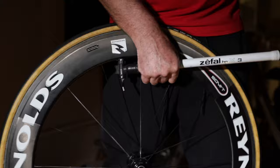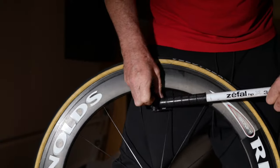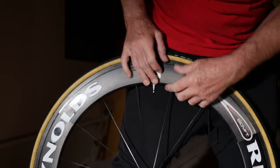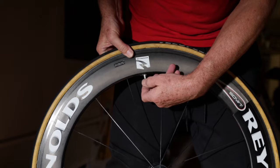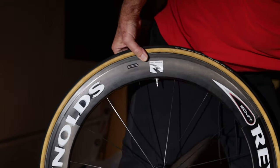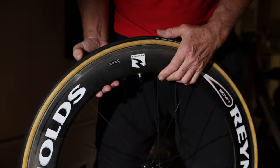If you're happy with alignment, pump it up really hard — 100 psi or more, maybe 110–120 — and it will really seat itself into the tape. The good thing about tape is the longer it's on the rim, the more sticky it gets. It actually beds in over time and you'll see it get squished out the sides with little bits of thread coming out — that's a good thing. Unlike glue, which goes hard after a time and actually weakens, tape actually gets more sticky with time.